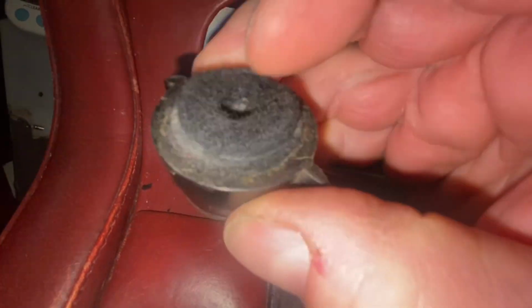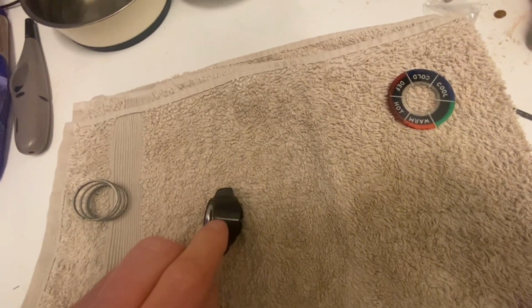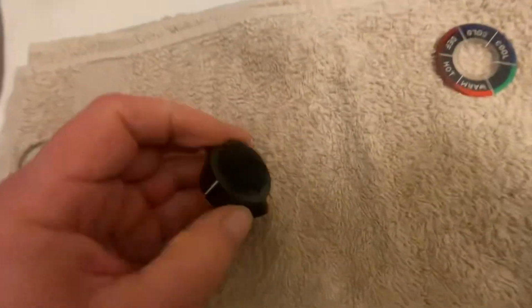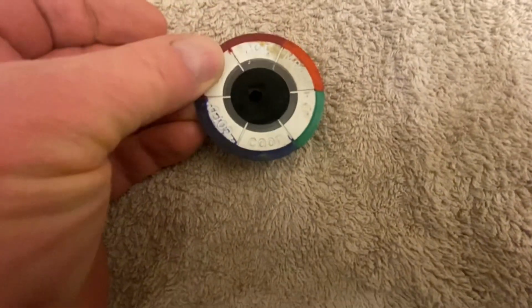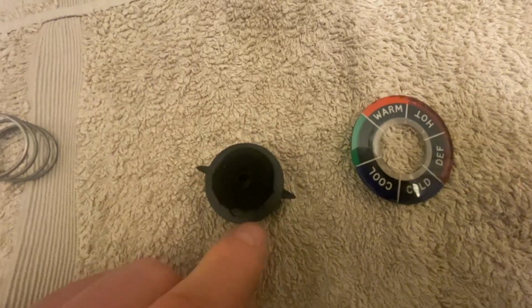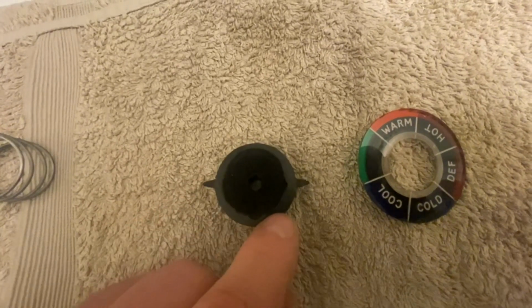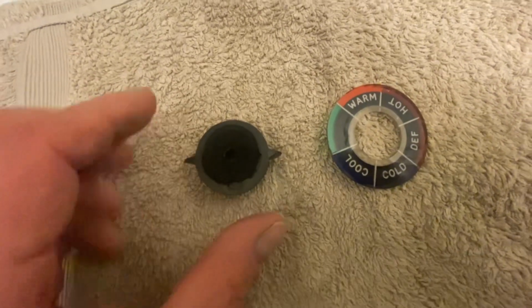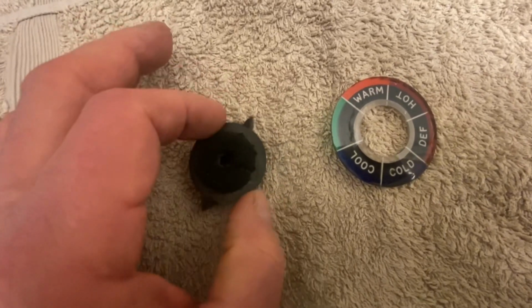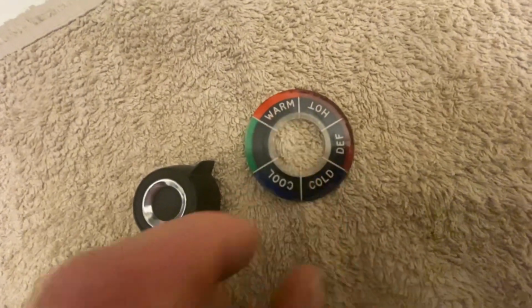And you can see you've got this little piece of felt. Looking at this knob, I've just reinstated the white line there. Originally I thought that this felt was supposed to go on the inside of that hole. But when I came to remove what I thought was just some accumulated gunk, it turned out to be more like glue. So I think all that's happened over the years is this felt washer has been worn away and should actually extend right over to the outside part of this and would rest on that clear area there.